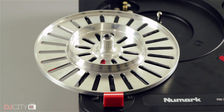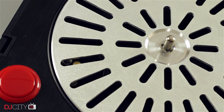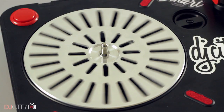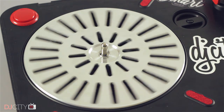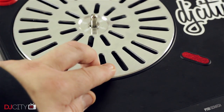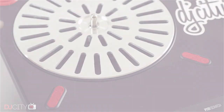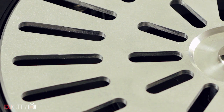It's available in two versions, with the standard having a solid top surface, and the premium — the one I've had on test — featuring milled slots in the top. Those aren't just for show. One big benefit of those slots is that it makes it super easy to reseat the belt onto the motor when you're putting the platter back on the table. The Solid Cuts platter doesn't seem to have much impact on the sound of the PTO1, although in theory a more torsion-resistant platter should make for a slightly tighter sound. But where it does have a big impact is with stability. There is a hugely reduced amount of up and down movement compared to the stock platter, with the Solid Cuts offering really living up to its name. The fit and sizing is spot on, and it made no noticeable difference to the speed of the PTO1, with zero on the pitch still being roughly zero — it's usually a tiny bit off as standard anyway, being a cheap belt drive table.